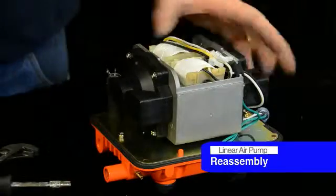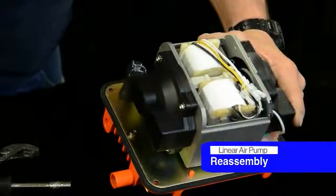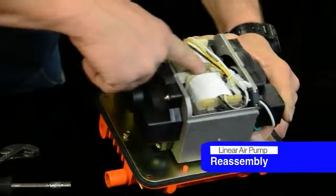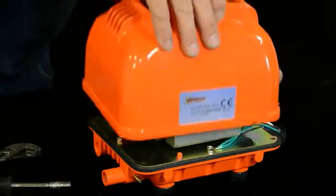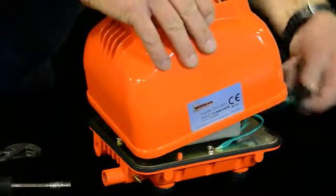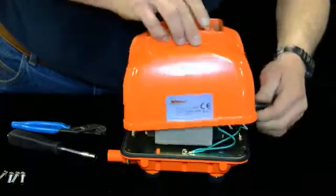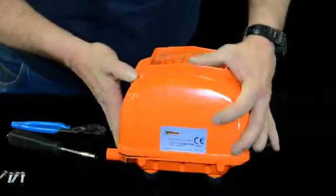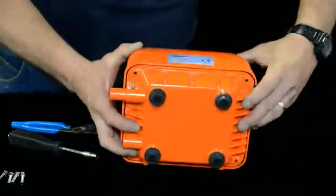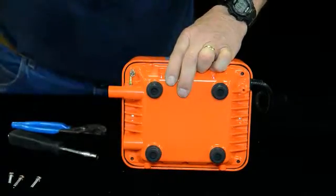We've replaced both sides and everything's up with the new parts. Everything looks good with the coils and the shuttle — no problem with the shuttle. So you can go ahead and put your cover back on. Be sure that when you do it, this cord end fits good in here so it doesn't get pulled out — it fits right into that housing. Go ahead and reinstall everything and put your screws in.